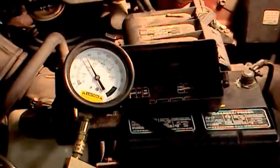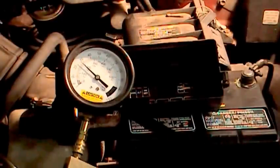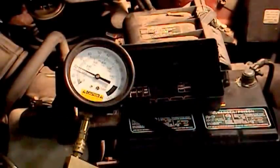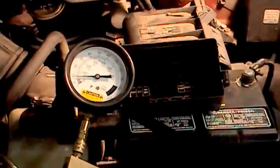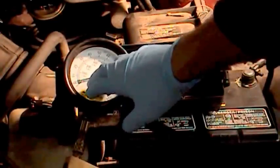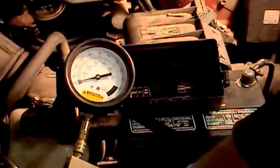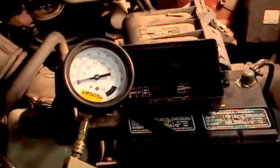As you can see, the pressure is already going away — it's pretty much already gone down about 25 pounds. It should still be holding down to 20 pounds, but there it goes. This fuel pump has a bad check valve; it's not holding fuel pressure on the rail. That means when it goes to start, they're having to wait for fuel to be pumped all the way from the tank to fill the rail up, pressurize it, and bleed the air out — the whole nine yards. This vehicle needs a fuel pump. Put a new fuel pump in and it'll probably fire up first time, every time. Thanks for watching.